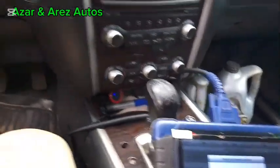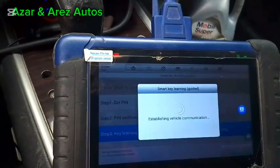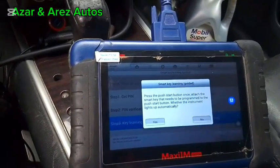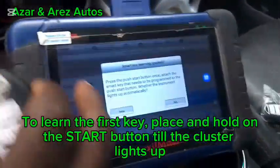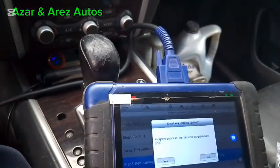The ignition dashboard normal indicator light is turned on — everything is okay. Turn ignition off within three seconds. So we'll press the push button and attach the smart key that needs to be programmed to the push button to see whether the instrument cluster lights up. So it has lit up.